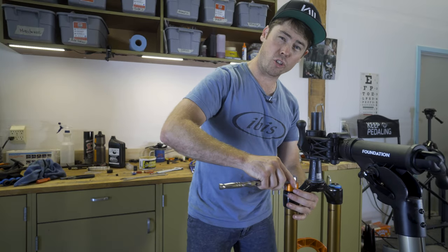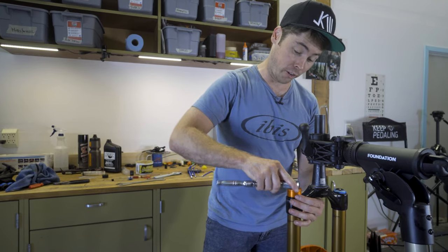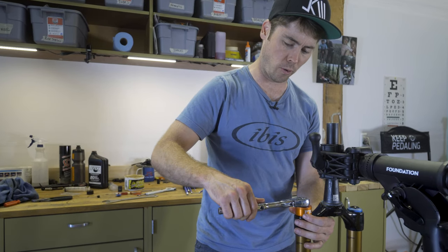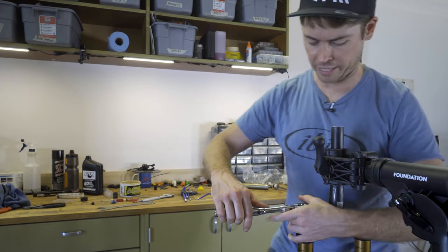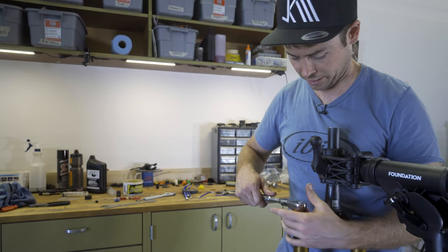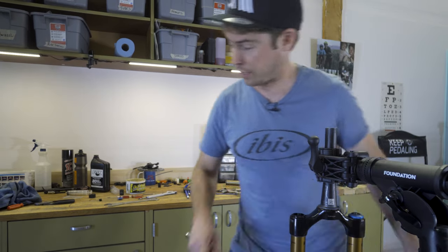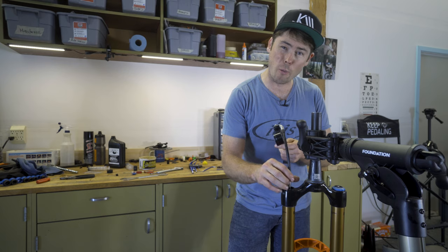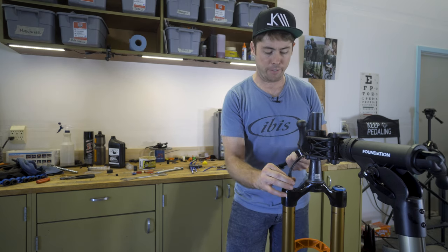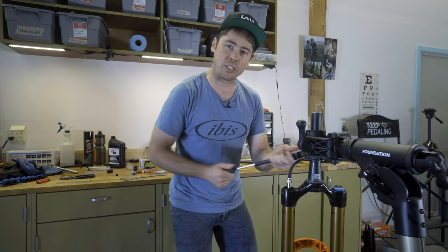Torque spec for this is 220 inch pounds, which I Googled, and sure enough, that's like, in a more normal term, like 20 some odd foot pounds, 24 or something. So that's pretty tight. I'm gonna get it probably not quite all the way up to spec, but it's not gonna be loose either. Okay, that's tight. And then I'm not actually gonna throw my full riding pressure in the fork quite yet. I might put like 50 PSI in here, just something to hold the fork in position while I'm sliding everything